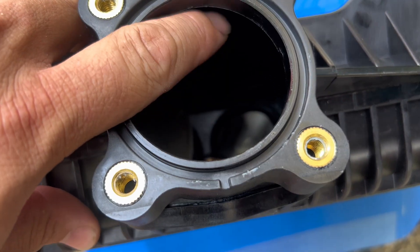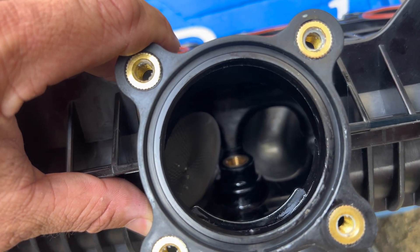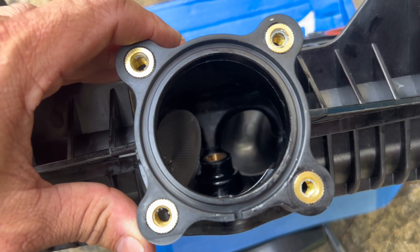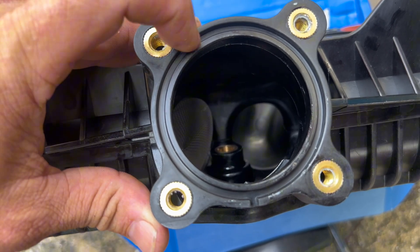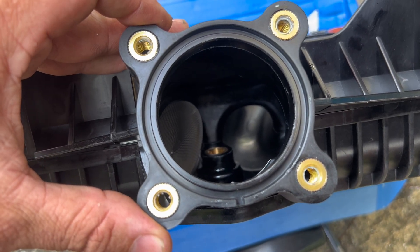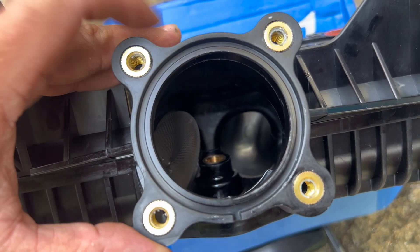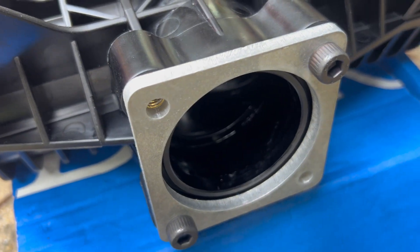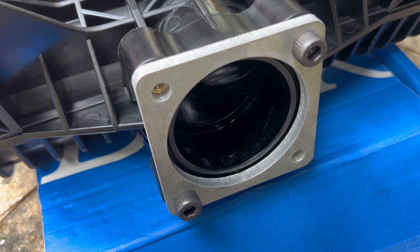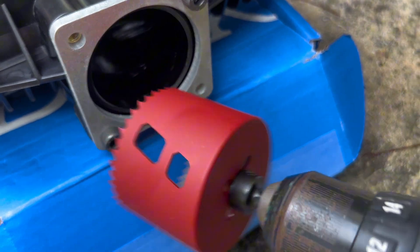There is a lip here, so you need to get this lip out of the way to remove the ribbon. You could crush it up with a screwdriver and rake away the plastic without buying the insert kit, but in this case I'm going to drill out the lip and install the nice Reva billet anodized sleeve. I've got the little template installed — they give you four bolts, I'm only going to use two. Those are 6mm Allens. Here's the drill bit included in the Reva kit.